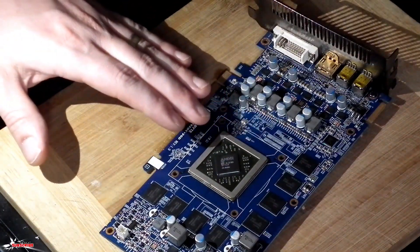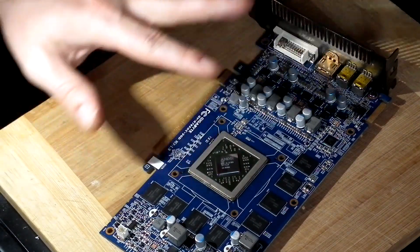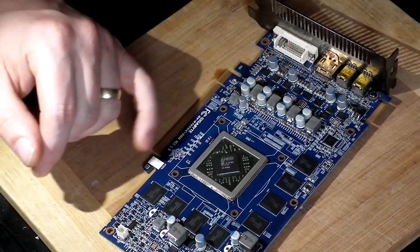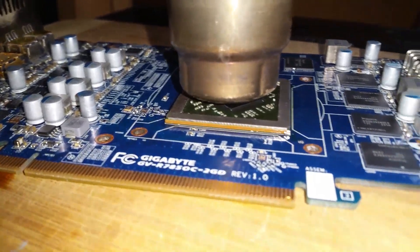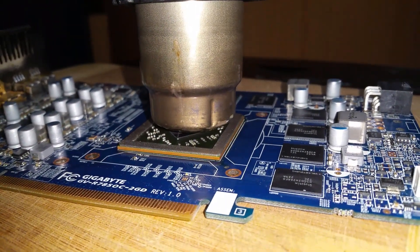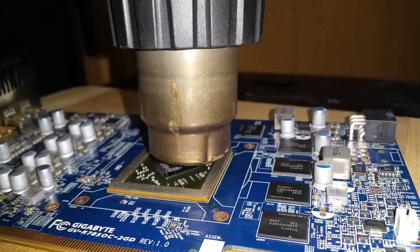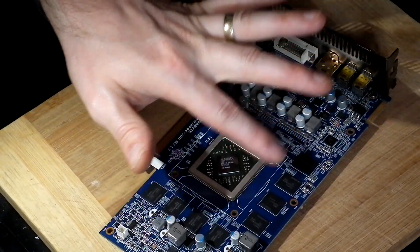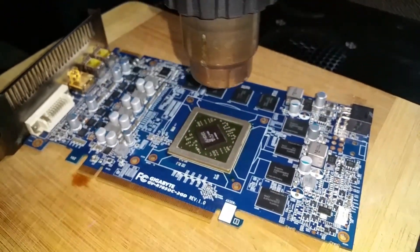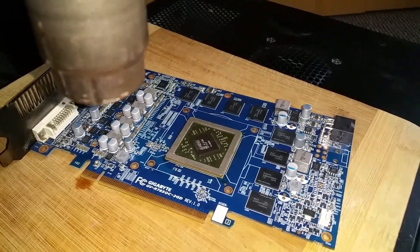For this procedure, heat the chip for about 10 minutes at 290 Celsius. You will start somewhere on the top, about 5cm from the main chip, and go continuously down and down. After about 5 minutes of heating, once you see all of the flux has disappeared, you will start heating the main chip very close - like a couple of millimetres from the chip - for about 30 seconds. After that, continue for each corner of the chip for about 10 seconds each side. Once you've done this, continue to do the same with every single RAM chip. After about 10 minutes of heating is passed, you will slowly lift it up, still using heat on the top. Once all done, just leave the card for 10 minutes - don't move it at all, because the card is so hot it is not safe to touch.